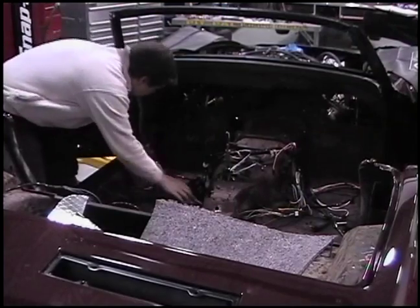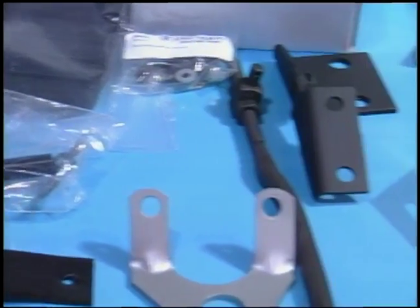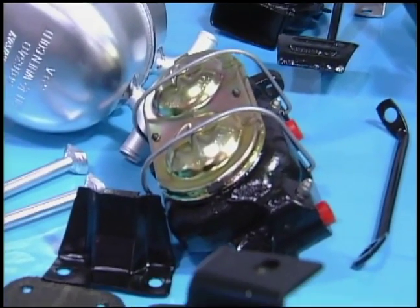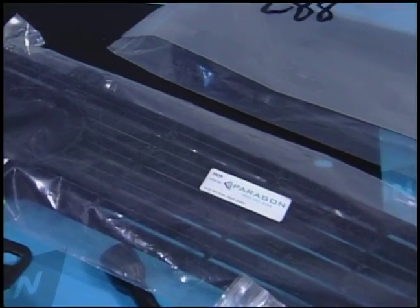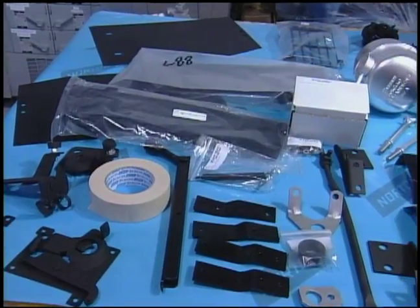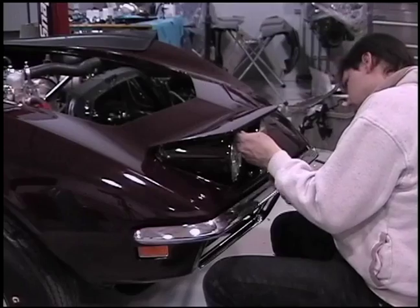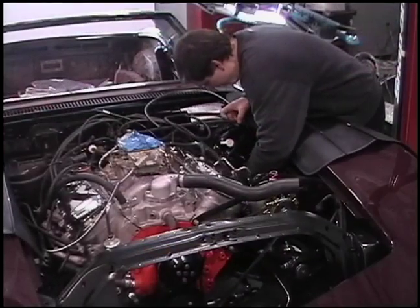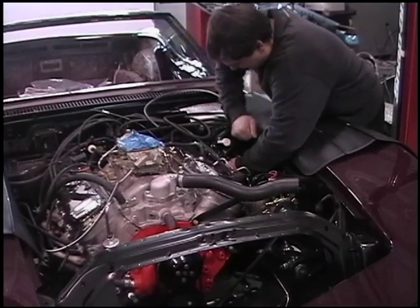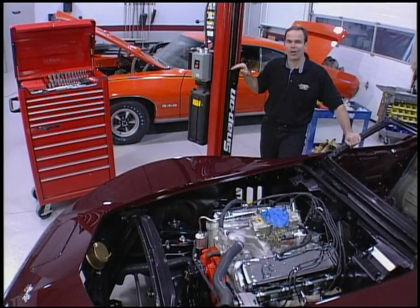The rest of it's like any restoration. If you take your time, lay everything out — we set everything out on a table here — make sure all the components have already been detailed and set. You don't want to be running back to the sandblaster, over to the spray booth, putting on one item at a time; it'll waste a bunch of time. Paragon supplied all the parts for this, so we know they're correct: the canister, the right anodizing, the hoses, the hose clamps, all the vacuum hoses with the right markings. It makes life a lot easier when doing a ground-up restoration to get the right pieces. The key with any assembly process is to make sure you take your time. If you scratch something now, it's going to take a lot more time to fix it. So just slow down at this stage, take your time, and things will go together actually a lot quicker than you think.